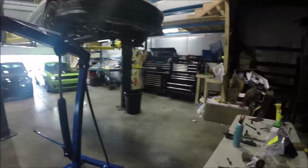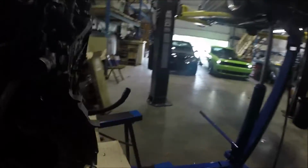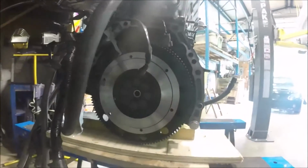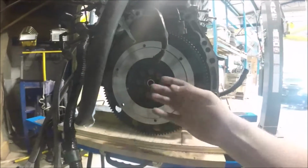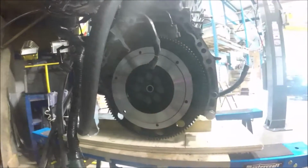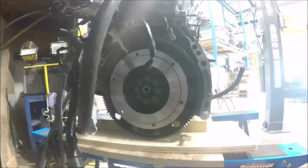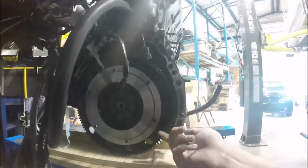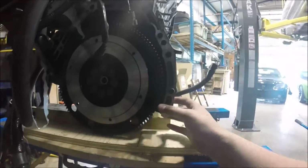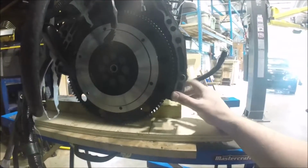Put the new freshly rebuilt transmission and start bolting the back up. So all I'm doing here, I just torqued my flywheel bolts, torqued those, set the clutch on, bolt them up, align the clutch. That's the biggest pain in the ass with the clutch. And then get your transmission to snap on, bolt the tranny up, and then set it in the car. This here, all I had was a pry bar in here, against the teeth, so I could torque it.